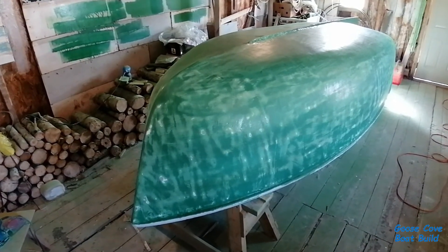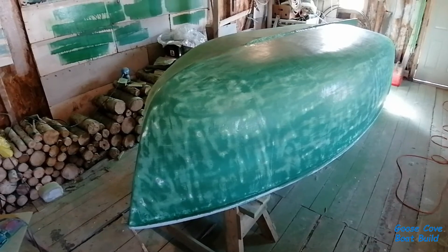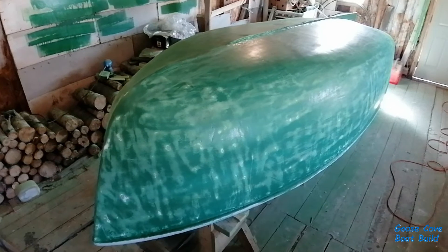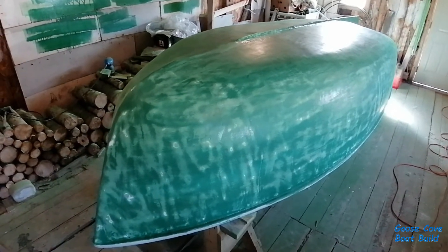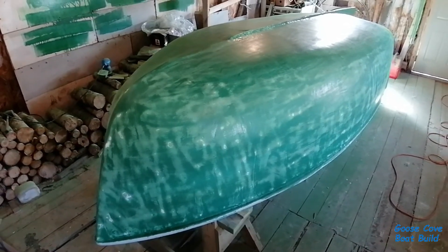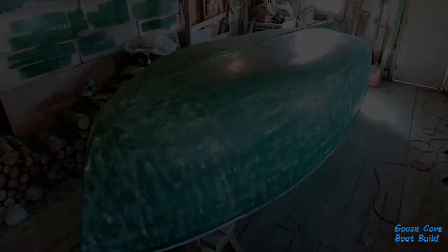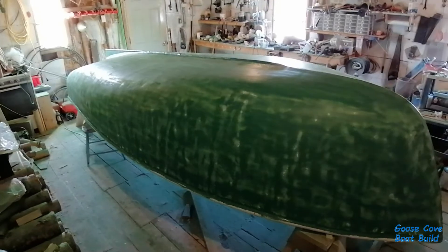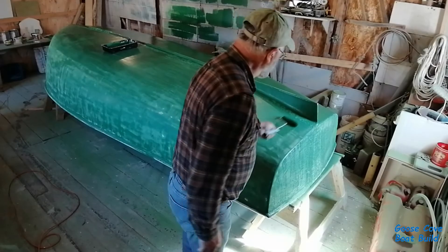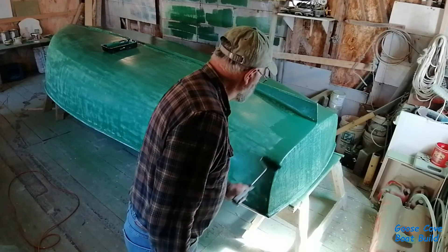As you can see, I did a little more extensive sanding than I'd intended. I figured since this was my last go with the sander, I might as well put a little bit of extra effort into it — certainly couldn't go to waste. For the bottom, I just scuffed it up a bit with some hand sanding, just to make sure that the last couple of layers of gel coat will go on and adhere a little bit better. So the last two layers to go on now will be numbers six and seven.